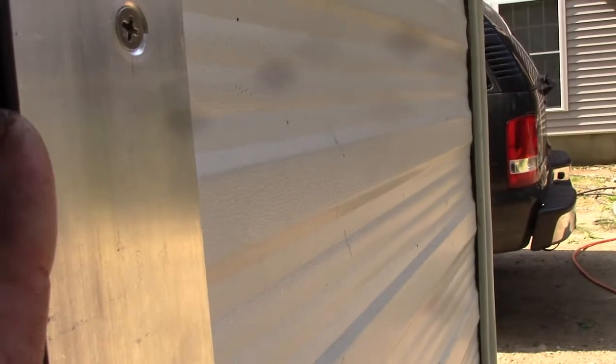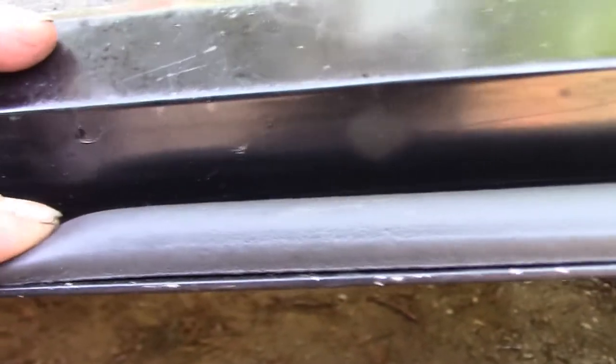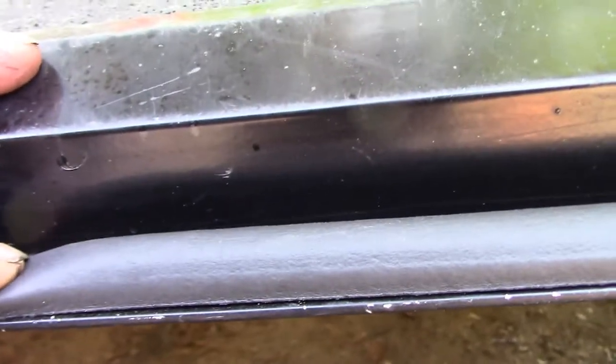steel structure, I put a 1/8 inch metal shim, and then a 1/8 inch strip stock of aluminum. And that aluminum is wide enough to push down on that steel shim, which is bolted to the metal tube, and then this captures the aluminum siding properly. And then what happens is when you adjust the door, the gasketing compresses down to as little as 1/8 of an inch. So I'm pulling this down probably from a 1/2 inch down to about 3/16.